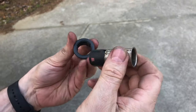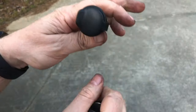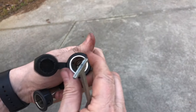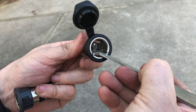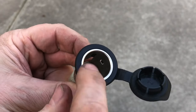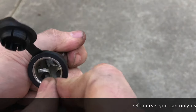Normally this assembly here is sitting in a bezel on the dash, and sometimes those bezels will have a little cover built into them. Whichever type it is, the way you get them off is with a special tool. It's like a T, and that tool is designed to fit into that little square cutout on the steel, and right on the opposite side there's another one. You can see there's a little plastic tab — these little tabs are what hold the bezel onto the lighter assembly.